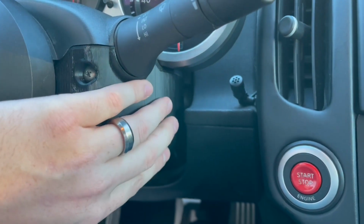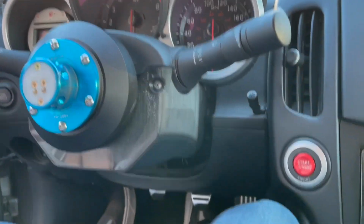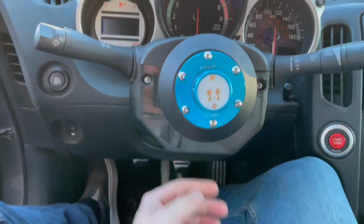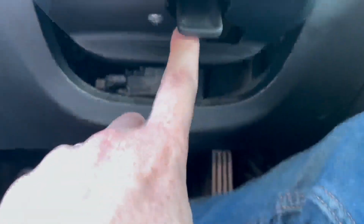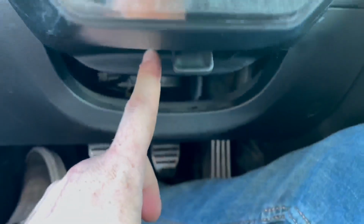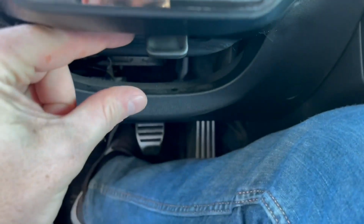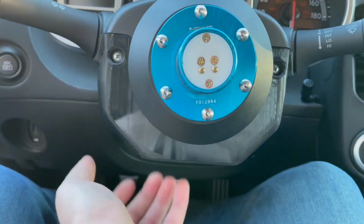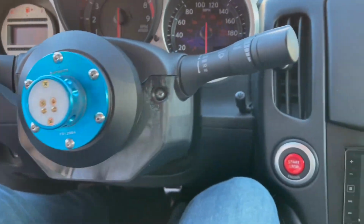But yeah, originally I made it out of PLA up in Rhode Island, and one day in the summer it melted like crazy. So this is an attempt with PETG. It's a little harder to work with at first, but I think it looks better than having nothing there, to be honest. The lever still goes there. It still uses this pickup point. The factory one came down to hide that lever. It stuck out like this much. So that's nice, and my legs clear it, and it's really solid. So I think that came out really good, actually. I'm happy with that.